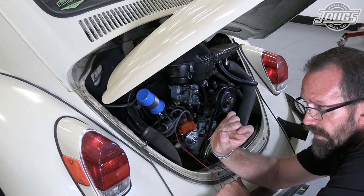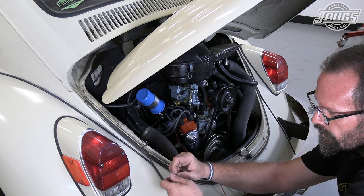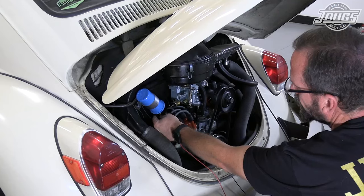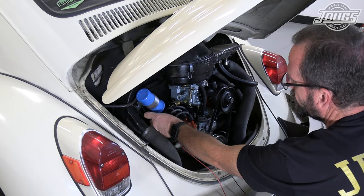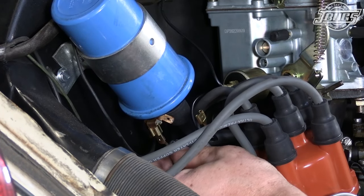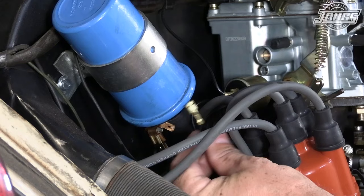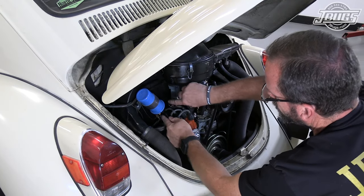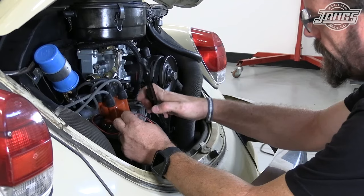You can pick up some piggyback connectors like this here. This will allow you to plug in two wires onto one terminal. Our idle solenoid from that terminal, along with our power terminal here. So we've got those two wires. I'm gonna plug on our piggyback over here. And I'm gonna plug in our power wire on one terminal and our solenoid on the other. All right, now that'll give me this terminal and this terminal for our positive wire and our negative wire.